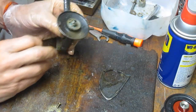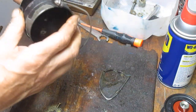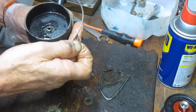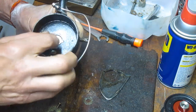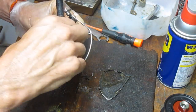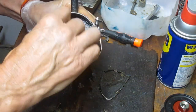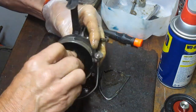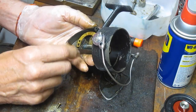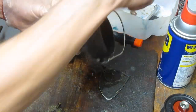With that done, let's put the rotor back on. The rotor is in good shape and clean below. Line it up so you can put the keyed washer in — it's not a rectangular face, so make sure you get that washer seated on both sides. Then go for the rotor nut. I'm tightening that down using the Mitchell tool — it's 12 millimeter, but a deep socket works fine if you don't have this tool.